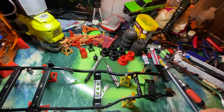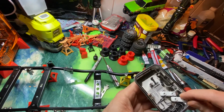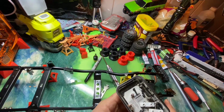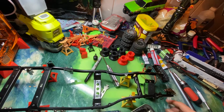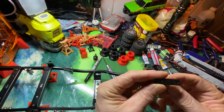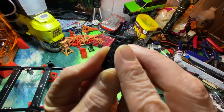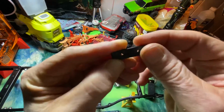And when I pulled the front end apart, you pull this metal piece out, okay? And you have these two white clips on the inside of the frame, so you got to kind of get a screwdriver and push them through the hole here, and they'll push out and get out of your way. And then you get your 3D printed mount, and then you get these spacers. And the spacers have got an arrow on them. See if you can see that. Yeah, there's an arrow right there. So you want to put that towards the front.